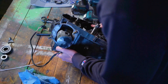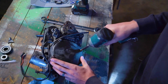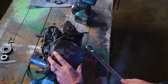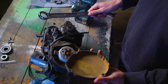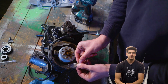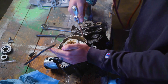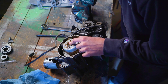So let's take a look. On the magneto side, or whatever this is in here. Look at that — I got another one. Something worth mentioning here is that later I find out you do not have to split the case to put the crank seals in. So if you are working on this motor in your bike, you can probably even just leave it in the bike. And this part is rusty.